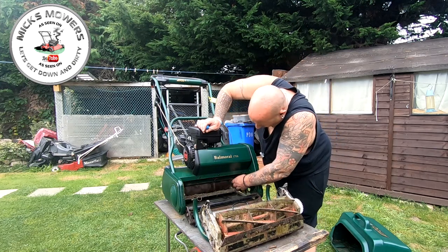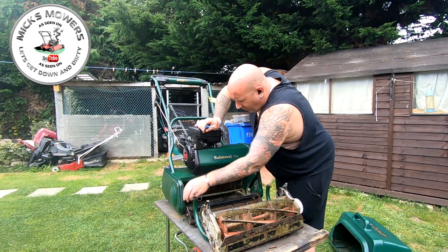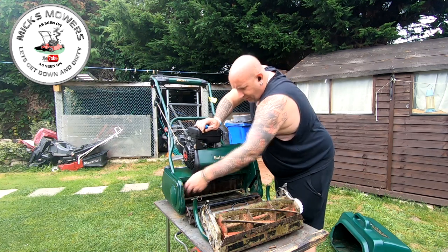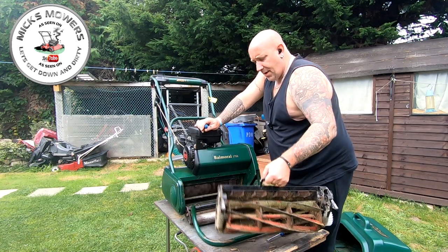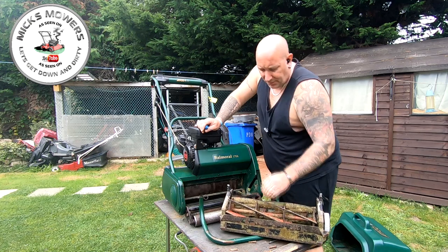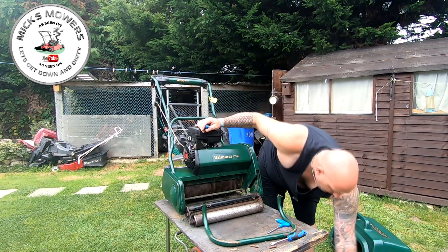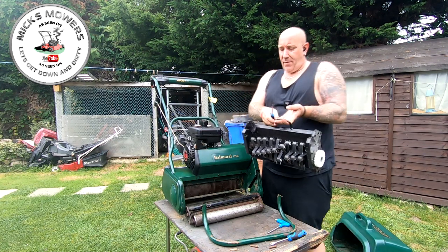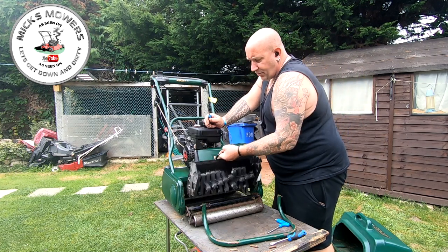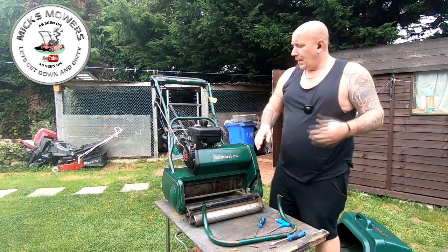Now's a good time to get inside here — as you can see all this grass and debris needs to be taken out, that's why it's getting stuck. What I would recommend after that is just to get some grease and rub it down the side of these runners just here. Now's a good time for you to either swap your cylinder over or take it away for sharpening, anything along that line. Your bed knife cutter is also on the bottom here as well, which can be removed for sharpening. Or if you wanted to, you could then install your scarifying unit. Unfortunately this one is a smaller one — this is for the 14, not for the 17 — but it would be exactly the same process, you just slide it back in and do it with two bolts. Let me just get some grease and grease this up, and I'll be back in two ticks.